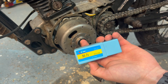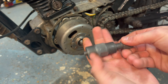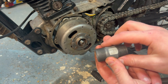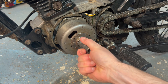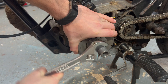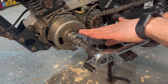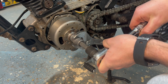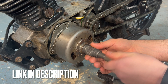I've got a special tool for removing the flywheel — let's try this out, I've never used it before but hopefully it should work. Just unscrew this — it's got two different sizes so it fits different flywheels, but this is a standard size so it should fit, which it does. We'll screw that in there. It's a left-hand thread, so lefty tighty righty loosey. This spanner here is locked against the peg, and now we can tighten the centre bolt up and that should pull the flywheel off. Brilliant little tool to have in the toolbox.